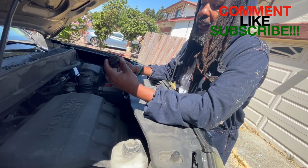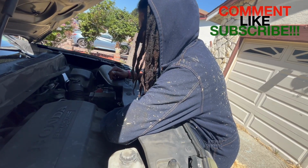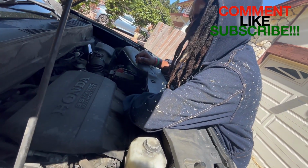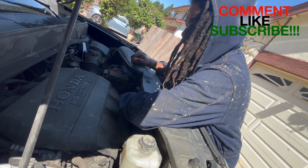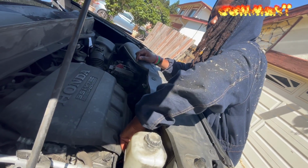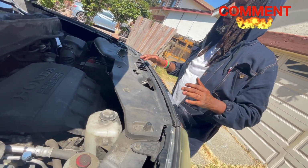Okay, guys, I took the funnel out. I'm gonna go ahead and put the cap back on. Again, tighten it slowly. You don't want to cross thread it, so wait until you get the thread biting. Then you can go ahead and twist it down. Make sure that you push that dipstick back down in there tight. Everything's sealed. Everything looks okay.